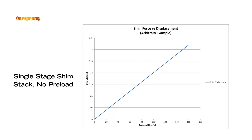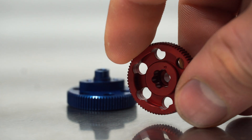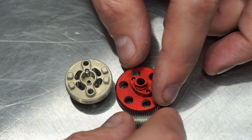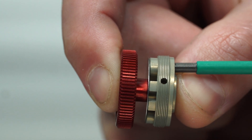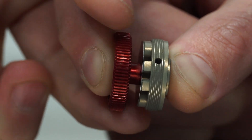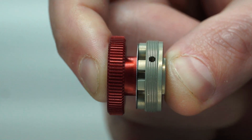Fundamentally, Rapid Revalve changes the force versus displacement characteristic — otherwise known as stiffness — of the shim stack, by altering the amount of leverage that the oil pressure has over the fulcrum of the shims. It does this by altering the effective shim clamping diameter. The variable clamp diameter is an effective clamping diameter provided by this elliptical clamping surface we call the variable clamp, which is what clamps the shim stack to the piston face. By rotating the variable clamp relative to the piston face, we can change the bending line of the shims, which in turn makes them require more or less force to displace a given distance. When the shims bend over the short side of the clamp, they easily displace a long way; when they flex over the long side, they're much stiffer.